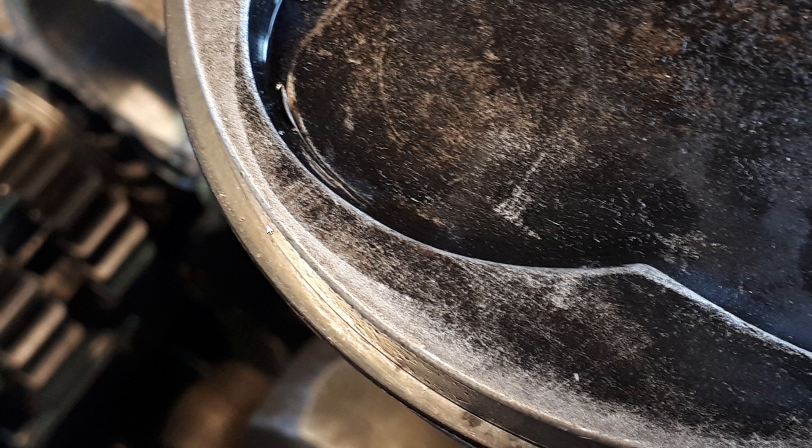It has been in contact here but there was no further damage and we found out real soon. So I corrected the squish through a proper clay test, which should have been done from the start. The squish is supposed to be somewhere around 1.0 to 1.2 millimeters for this type of engine configuration.